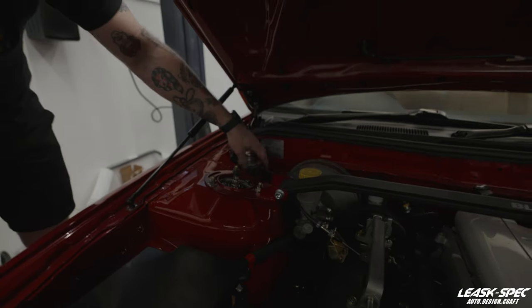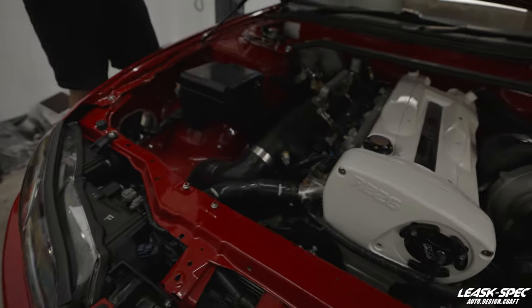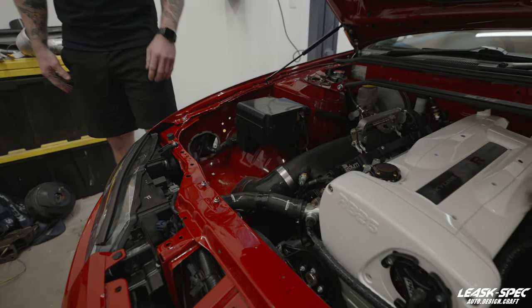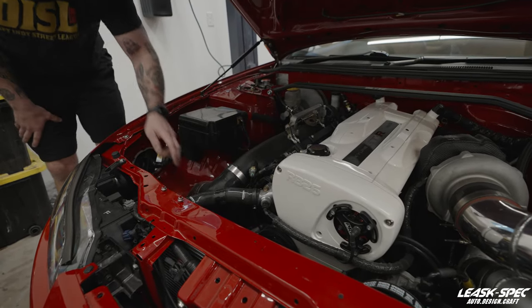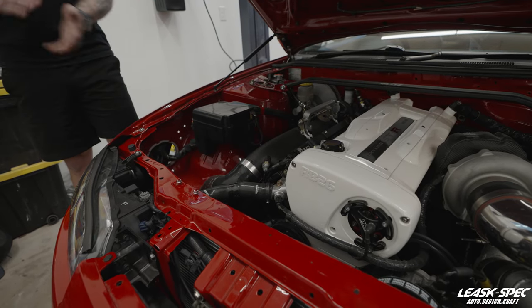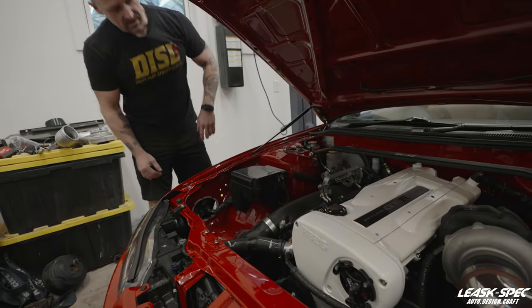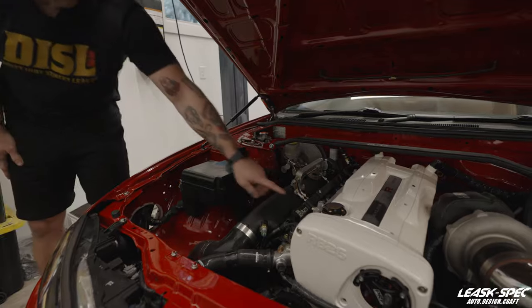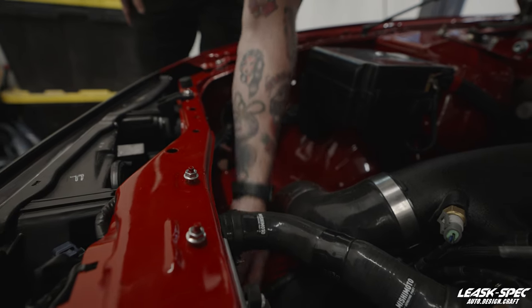However, if you look through down here, this is a twin-pass radiator and that can is only being fed by the lower pass. What that means is you are getting a high spot and you're able to bleed off some air, but the entire upper pass itself isn't actively being bled from. So you can imagine the upper half of the radiator, this mid-manifold, anything coming out of the upper radiator hose, anything going through the turbo — that's not inherently going to go to the higher point and bleed off air as the system runs. So I'm going to modify this — using that lower line to act as a draw on the can so the water pump creates suction on it, and then feed it from this bleeder bolt as well as another line adapted at the highest point of the radiator so we're bleeding off the upper partition, not the lower one.